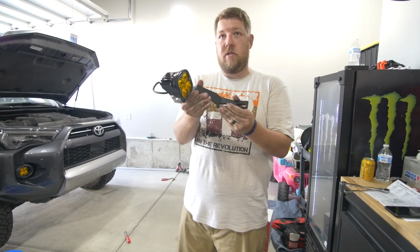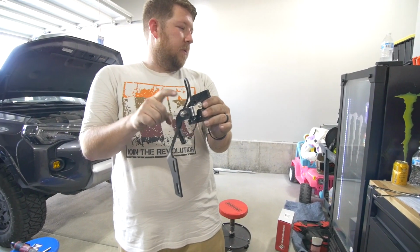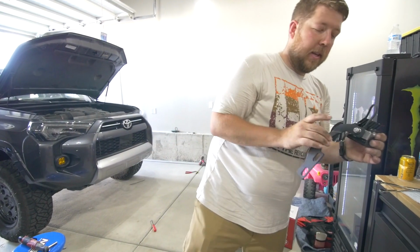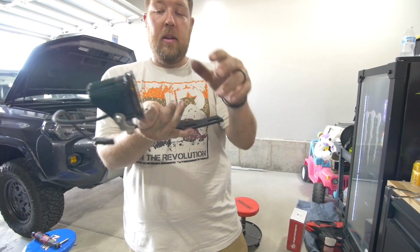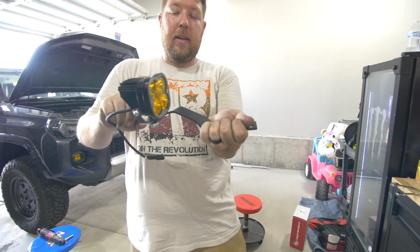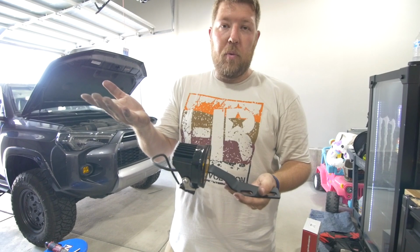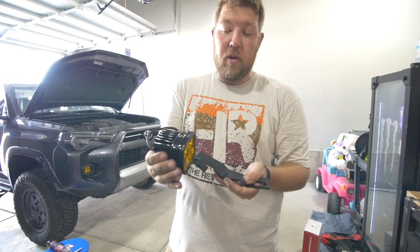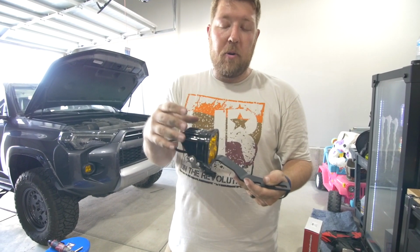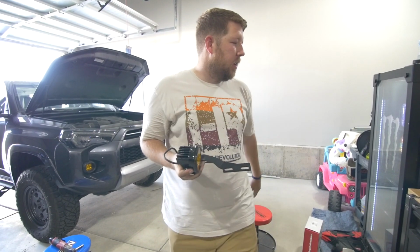So this is passenger side? Yes, sir. So the passenger side one is on there, and we use the 14 and the 9/16 on the bottom just to tighten it. So it's snugged up on there, and this one you can still play a little bit, so we can tighten these once it's mounted and we get these adjusted to however we want. And also, if you wanted to, you could turn this if you were doing more of a wide cornering and point it more down towards the front right of the car for the passenger side.